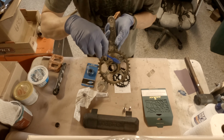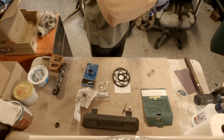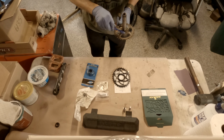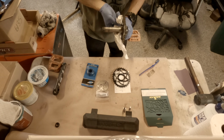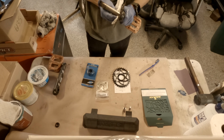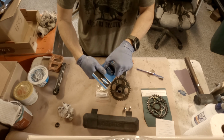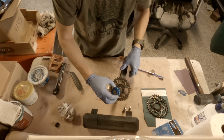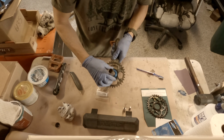This side right here is the little nut that we have to take apart. That is pretty dirty. LRT-4 is the Park Tool. Shimano direct mount, 41 millimeters. And this should just go down. Yep. And then it just locks in place there.